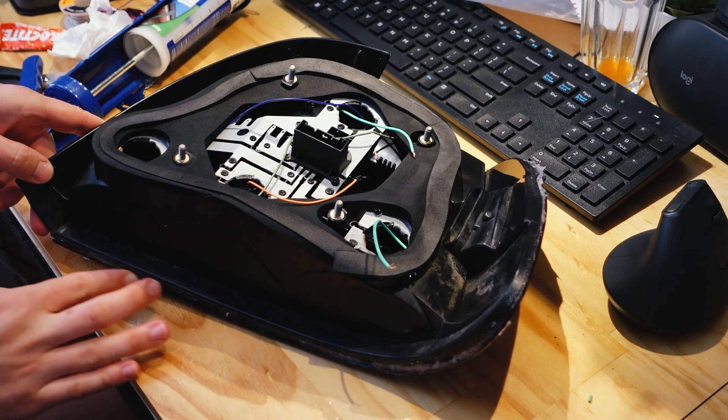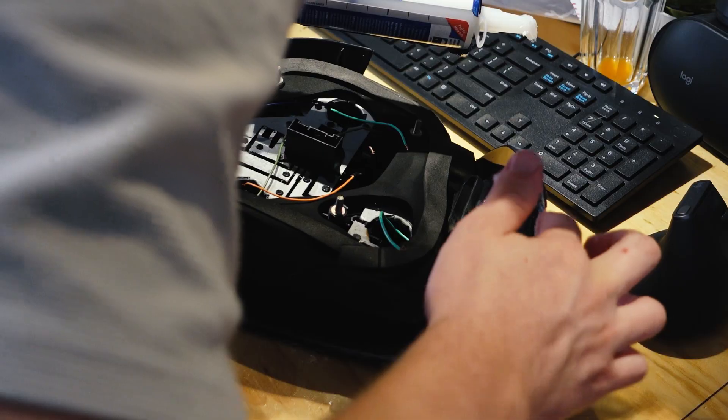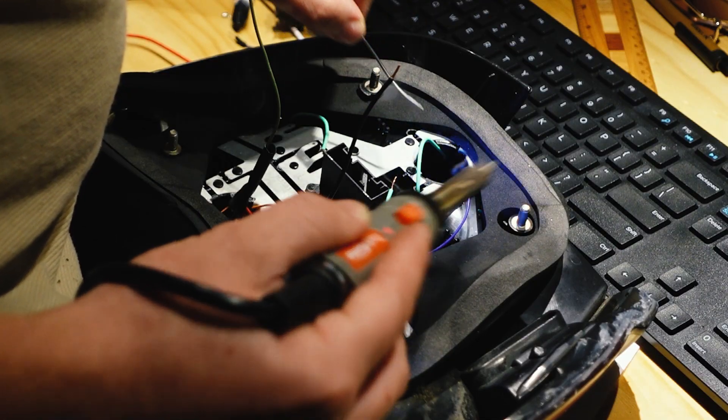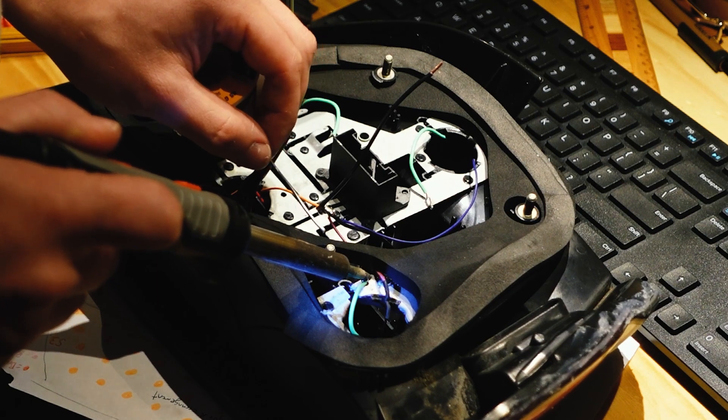To get everything connected I'm wiring the LED modules to their corresponding source on the metal plate behind the housing, which means I can keep using the factory plug. But to get them to bond I had to drill holes in the plate to expose raw metal for the wires to solder to, as the galvanised coating of the plate rejects solder connections if you leave it as is.